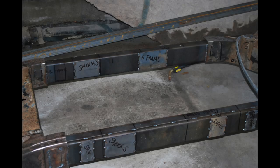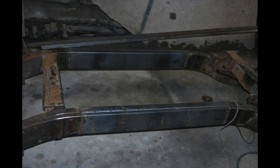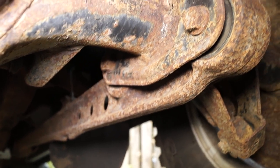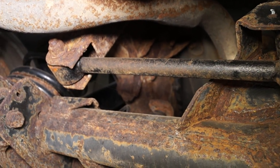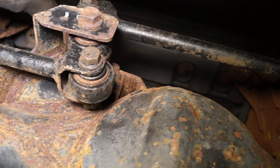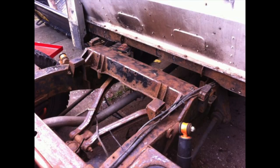There's a link below which will take you to a website page showing what this guy did — he's double-skinned his chassis to get the right effect. I'm not looking to get a box section, but the two channel sections are welded together which makes it look normal. What I do like on the rear end of the Discovery is the tie rods, which have got very substantial bushes. What I don't like is the Watts linkage — it works, however it's not what I'm used to. I prefer to have the traditional A-frame, so we're going to have to modify the axle and the chassis to accommodate for this.